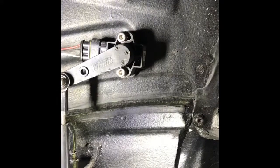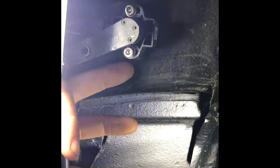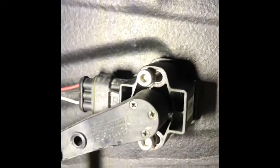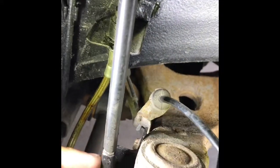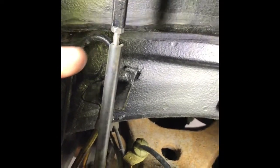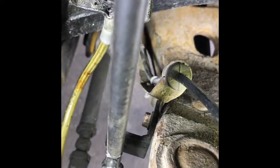For the back wheel, I've added the sensor about an inch and a half from this bottom edge. On this one you do have access to the back side, so I decided to use bolts instead of washers. I've drilled a hole in here and put a grommet to minimize the wire running through. The distance from the bottom side of this nut to the top side of the other is five and 13 sixteenths inches.